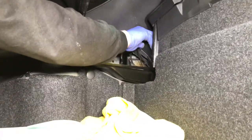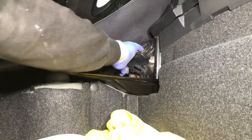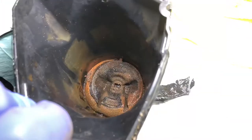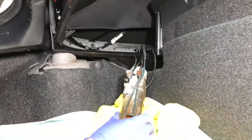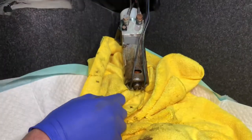We're trying to separate the water-filled bucket from the motor because as we bring the motor back we don't want to drag the bucket with the rusty water into the boot area. Whilst we're in that compartment we're trying to turn it upside down to drain out through the natural drain process — that's what we're seeing coming out down the bottom onto the floor, just to help keep things clean. We've separated all the cable ties and there's the bottom bucket — the one that would have been full of water that caused the motor to fail. It comes out relatively dry as we'd probably tipped most of it out, full of rust and corrosion. And here comes the actual component that's failed, with electrical wiring going into the bottom and four hydraulic pipes at the top connected to the banjo port.